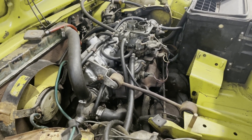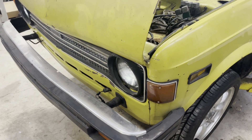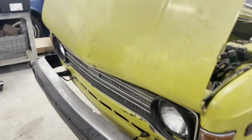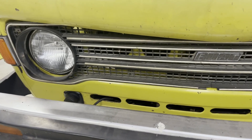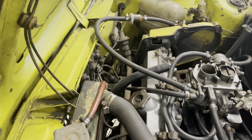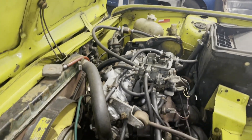The other thing I've got to do is some cosmetic stuff that overlaps as well. I'm going to remove the giant bumper - I already removed the rear - and I'm going to swap out the grill. On these cars it's nice to have the grill removed because right through that opening is the best way to access the distributor and the front part of the engine where the spark plugs are and all that.